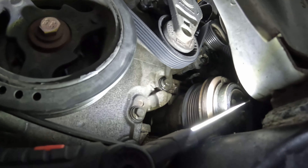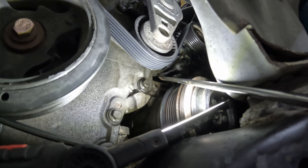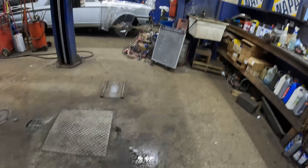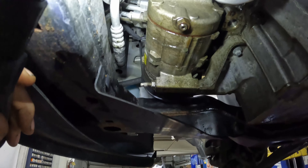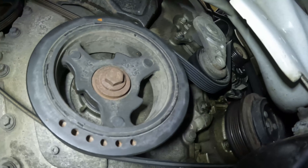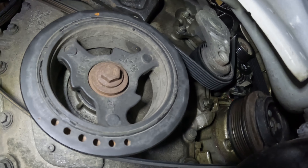Again, sorry for the camera angle. It's kind of hard to get in there, but right there you see the drips. If we kind of look at it from the front here, that's a pretty significant leak there. It usually drips right off the AC compressor. But yeah, it's very hard to tell. You can't see it from up there, really. I think what I'll do is pull that belt tensioner off and see if I can get you guys a better look at where that weep hole is.